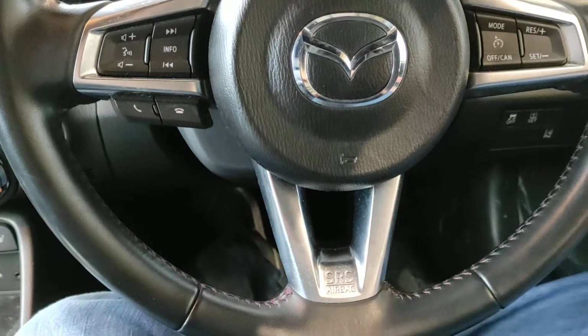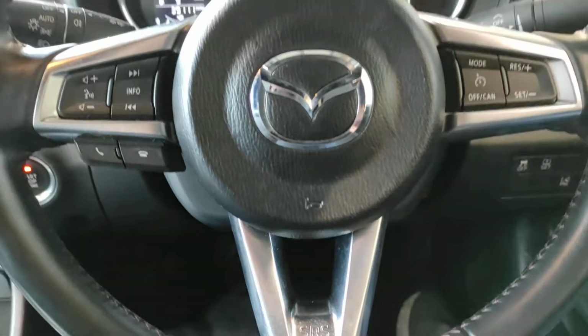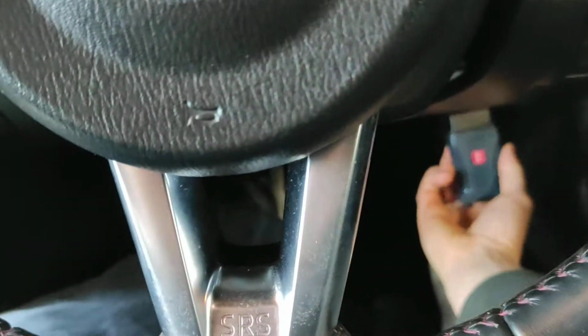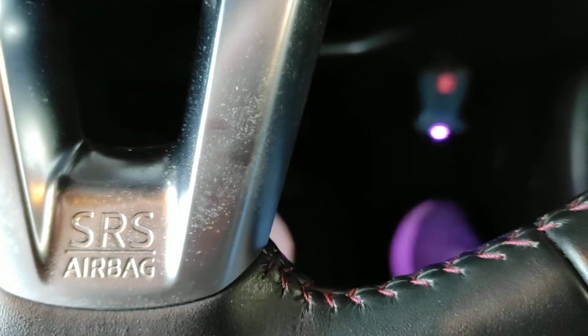Now I think we can see the OBD port is just under the dash here, and we'll just try and angle it so we can see the LED on the tool as well. There we go. A little purple flash was a force ignition indicator, but we don't need it because we've got the ignition on. Lights up my shoe nice and green, but yeah, 2 green beeps show us 2 keys programmed.